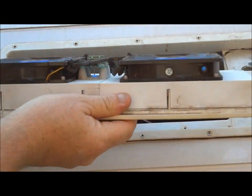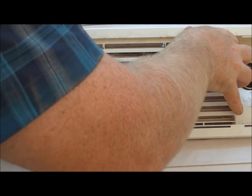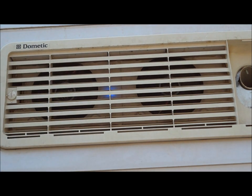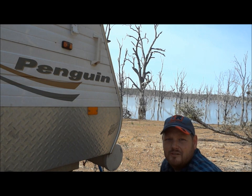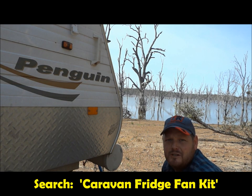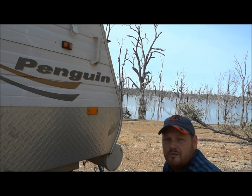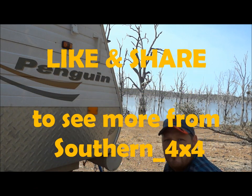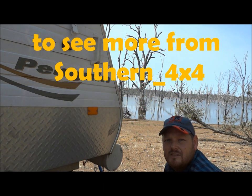The little blue light shows the fans are operating. And then if it sucks the air out and it drops down to a better operating temperature for the fridge, the fans will switch themselves off — they've got a little thermocouple in there, and that little blue light would go off. If you're interested in making this modification to your van, go online and search for 'Caravan Fridge Fan Kit'. The kit I got had everything in it, including instructions on how to fit and install it — it was very, very simple. And it has made a world of difference to our summer camping in the caravan, because extracting that heat out from around the compressor has made the fridge run much more efficiently. Check it out and see how you go.